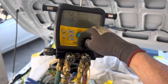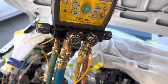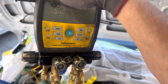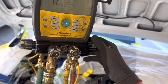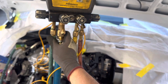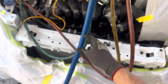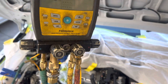When the micron gauge is located inside the manifold, it'll show a different number because it's not reading the actual system. If you want to take your skills up a level, get a FieldPiece SM480V refrigerant gauge. For small shops and do-it-yourselfers, also get the three-quarter-inch silicone vacuum hose — they have adapters and it doesn't require a big vacuum pump, but get the silicone vacuum line.